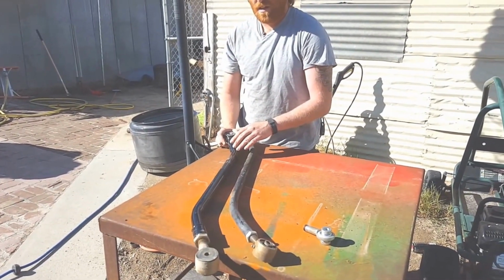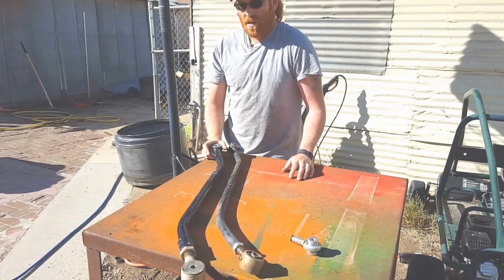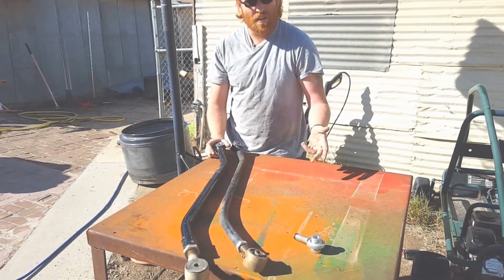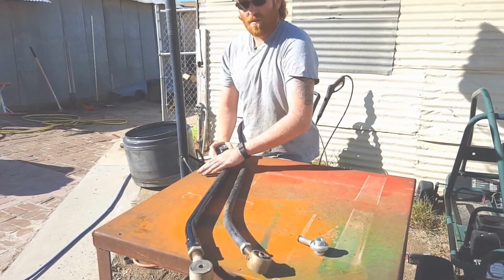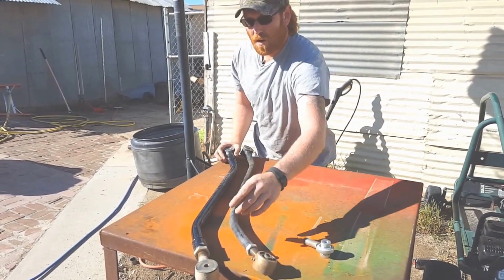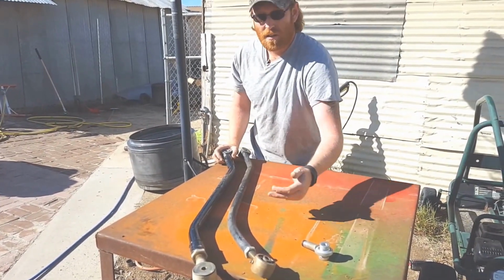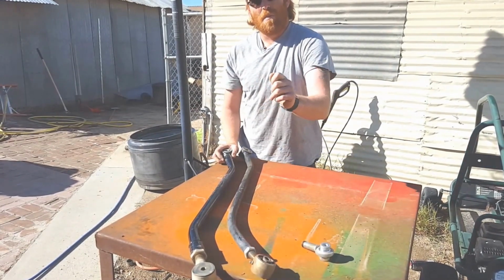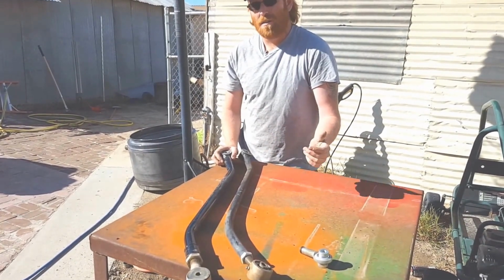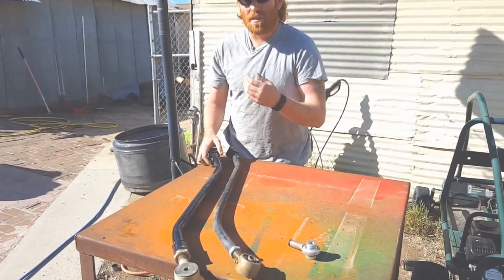This has been on there now for, I don't know, 5,000 miles or so. No issues. Both of the last off-road videos I was in, the flex test and the Crocker Springs run, this track bar was in it. No issues whatsoever. The only reason I really took it out is for the video. And where it bolts up on the frame, I added some washers in it just to make it a little more rigid, because of this and this, bouncing around, it walled the hole out a little bit. So I went and got some heavy duty 1/4 inch thick washers, drilled them out the exact size of the bolt, and welded those in just to give a little extra strength right there, but it wasn't really necessary.